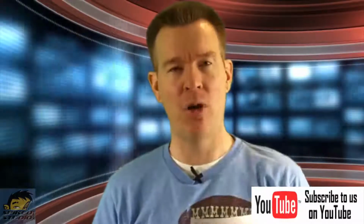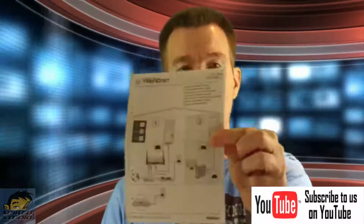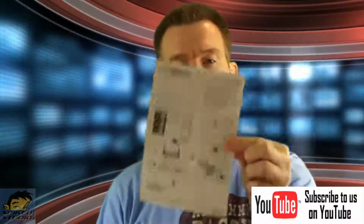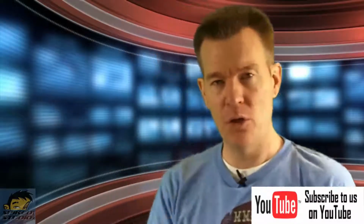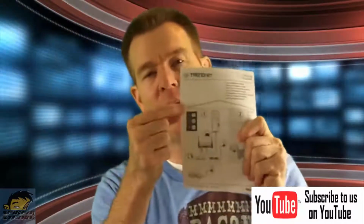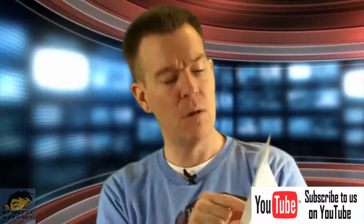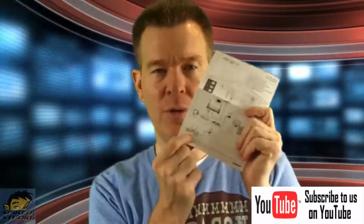One thing you should note, and they put this on the diagram, but they don't highlight it very well, in my opinion, on the diagram to say it's a quick installation guide. It has 2 steps on the quick installation guide. Just 2. Plug it in and it works. That's the 2 steps. But you need to note exactly what it tells you to do on the very bottom. It's telling you, by the way, it's EU, US, and UK adapter certified. On the very bottom, they tell you, do not plug the device itself into a power strip.